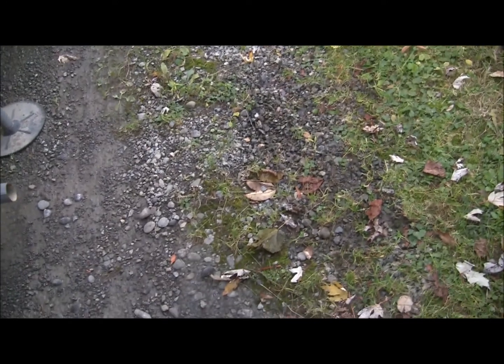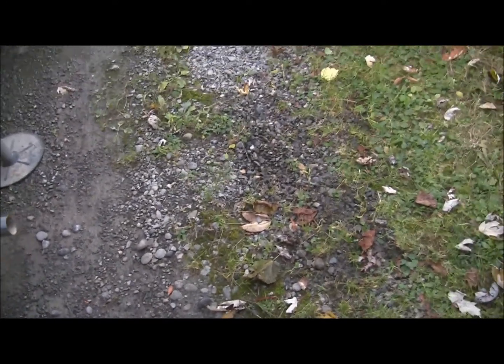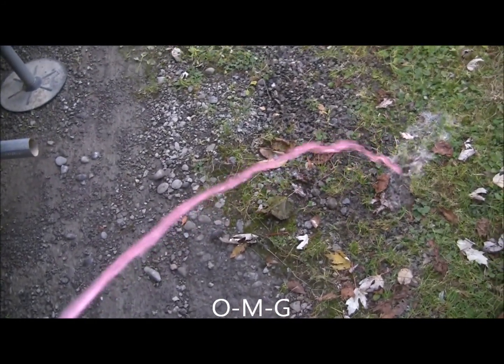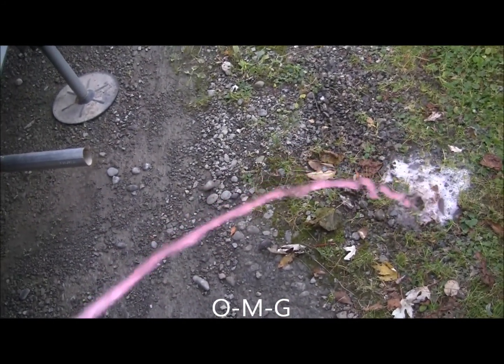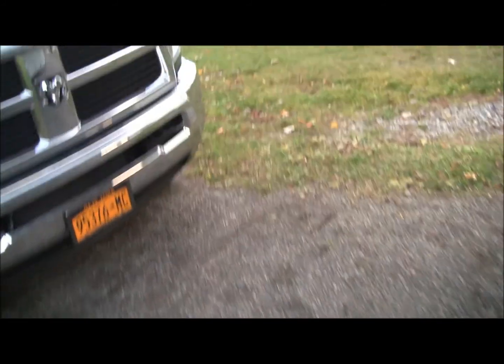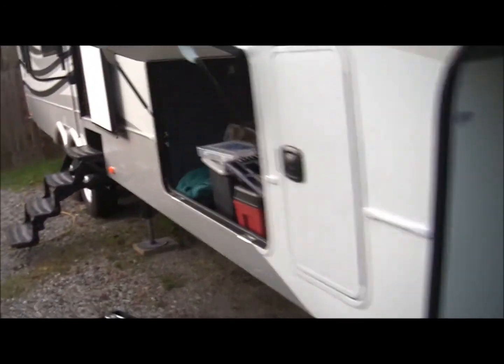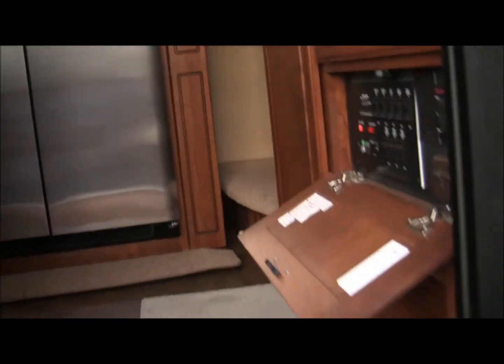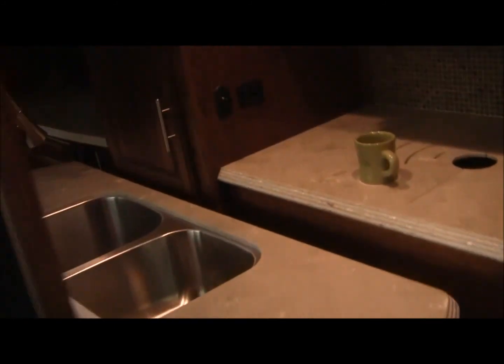It's kind of a pain with that winterizing kit. But there we go, we got some pink there coming out of the outside. Now, work our way inside. That hose, it stays coiled, so we have a hard time getting it down into the gallon jugs and having it hold there, so it takes a little finagling.